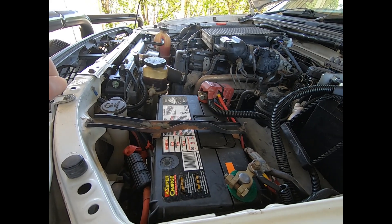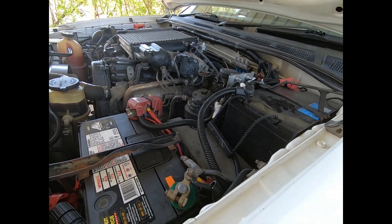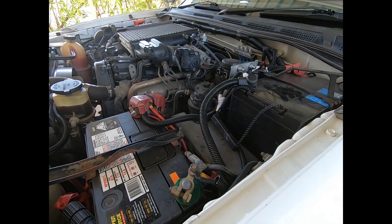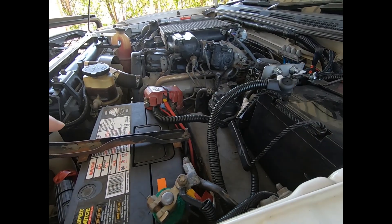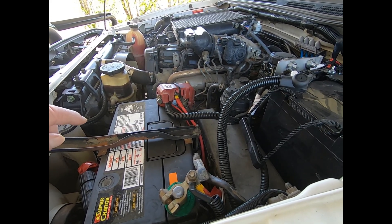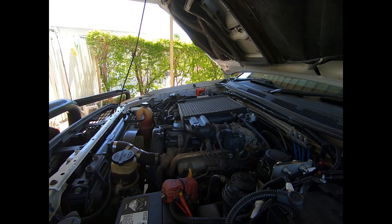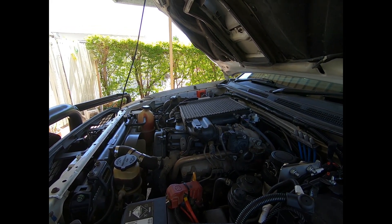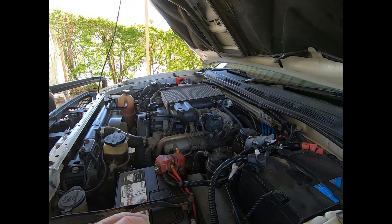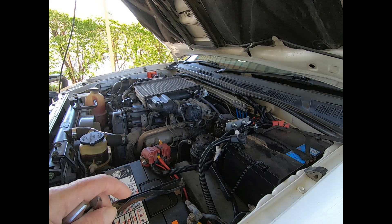The first step to do with any electrical repair like this under the bonnet is to disconnect your battery. I disconnect the negative or the black wires, because once you've done that there's no circuit. So I'll disconnect the black wires — the two black wires — and then work from there. Then I'm going to take the old unit off and mount the new unit, checking the wires again. Disconnecting your wires first is a really, really important first step.